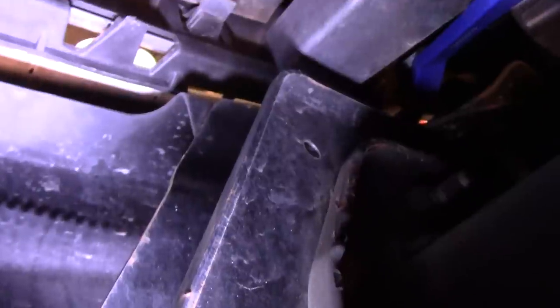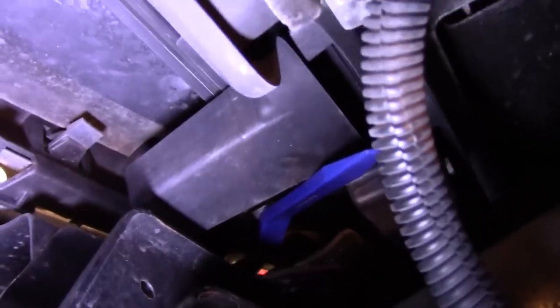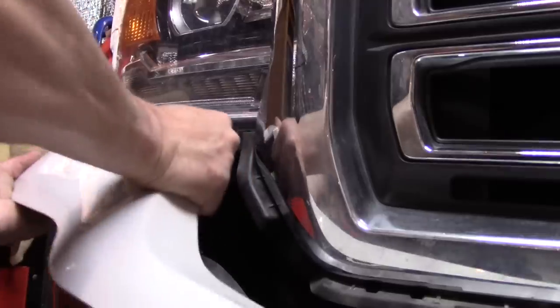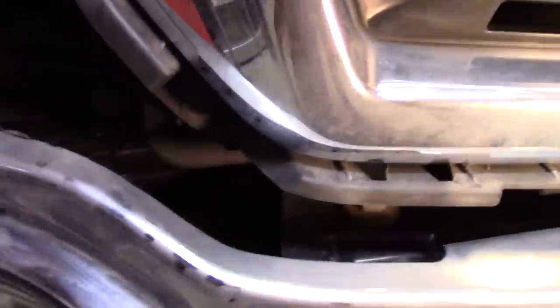Just like that. You can see one-handed operation — that little tool, or any kind of flat tool. These trim tools are nice because they're plastic and they shouldn't mar it up too much, but even a chisel or something would work. It's all free except for this corner here — and there it is. Set that aside. Now we're looking at the grill bolts right here. We have four lower grill bolts, and they're 10 millimeter. Let me grab a ratchet and start pulling those.